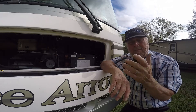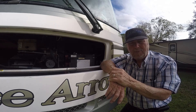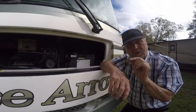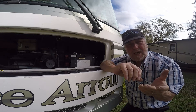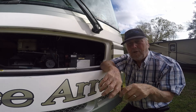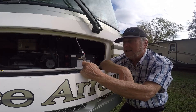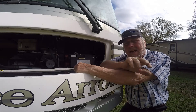That would be another problem. This happened to be something where the wires actually pulled out. You have to watch for shorted wires. If you plug a fuse in and it blows right away with the plug unplugged, then chances are you've got a nicked wire back there. What you would do is look at that pigtail all the way around where it comes in contact with the metal frame — chances are it's been cut down and it's touching metal somewhere. But if you replace the fuse and everything works, then chances are you just had a momentary ground, which is what I explained — the wires pulled out. So get yourself a little test light and have it available, get your owner's manual, and investigate your fuse blocks and see how many you have.